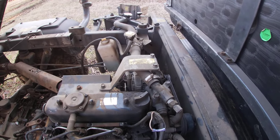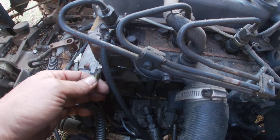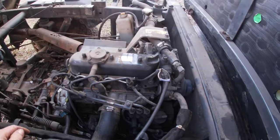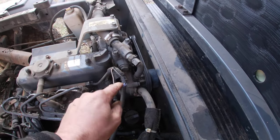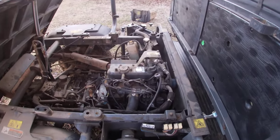With the key on all the time, you'll still have your temperature gauge. You can check it — pull it off back here — your gauge will fall, go back up. You can ground this out and it'll make the gauge jump, tell you your gauge is good. Do the same with this — if you tie these together that fan should run. You'll probably need to use a power probe, not cut your wires.